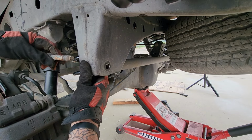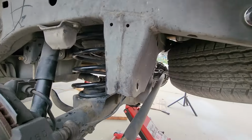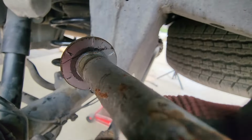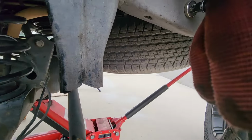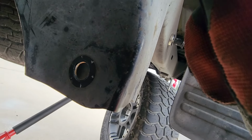And the bolt comes in from this side. This is something a lot of you Toyota guys know, but for the new guys, if you look at this bolt, you see 6 little ridges. If you're ever wondering which way the bolt goes in, you just check the hole. Nothing there. 6 ridges on that one. That's an easy way to identify which way a bolt goes in.